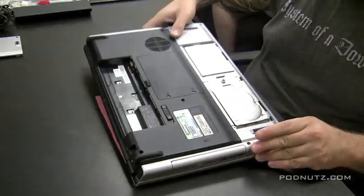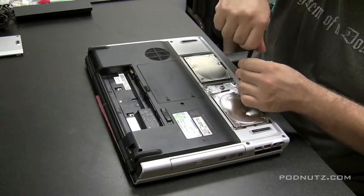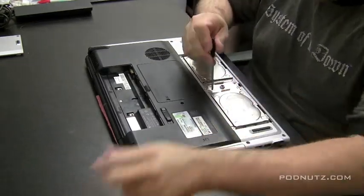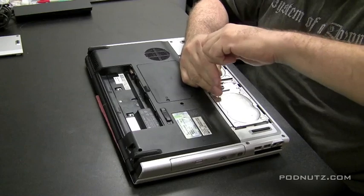And now, we're just going to inspect to see if we see any signs of water damage. And under that hard drive, you can see the white — that's from liquid, that's from water. So, the water, or the iced tea, actually got down through the computer to the bottom of the hard drive. So, it made it through the system. So, I don't even turn the computer on until I check if the motherboard's okay.